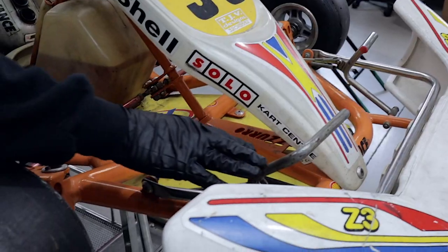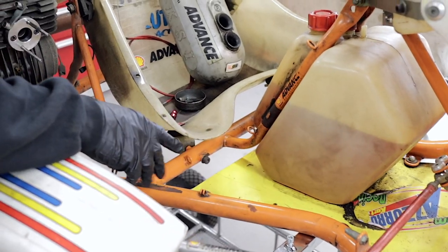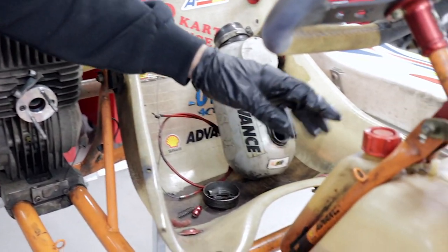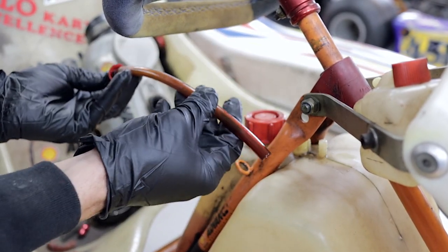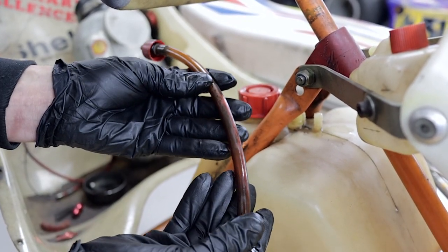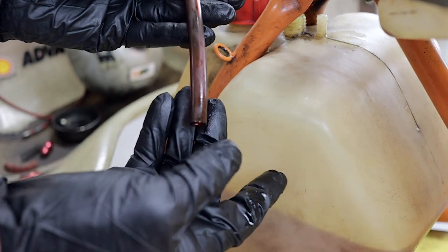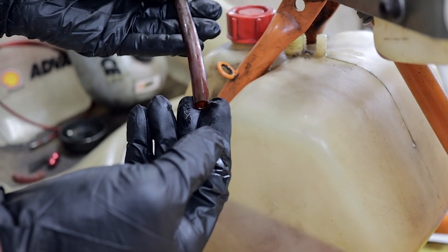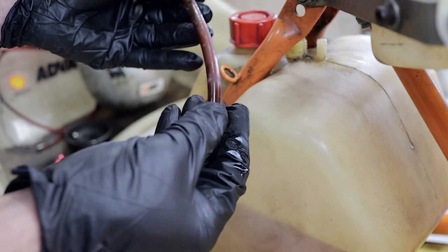Let's go see how Mitchell's getting on. As you can see, Mitchell's been working on the orange machine. We've got the throttle cable and the fuel line removed, carby's off, ready for a carby kit as well. If we go over to the fuel tank and pull the pickup out of the tank, you can see that this is the hose we talk about that can perish inside the petrol. If yours is falling apart, make sure you drain your fuel and put in some fresh fuel. This one should have a little lead weight on the end of the fuel line and it's fallen off or it's missing, so we're going to drain this tank and double check, then add a new one and some new fuel line.